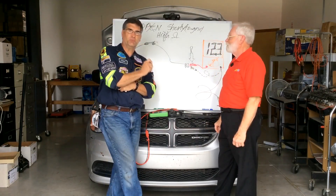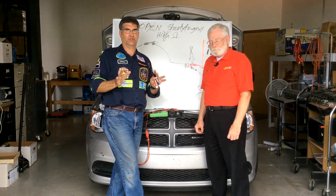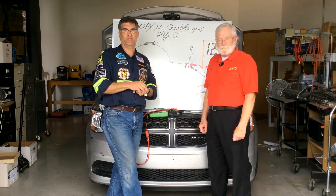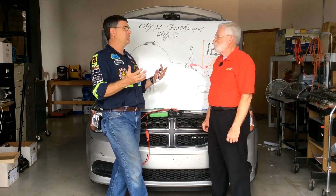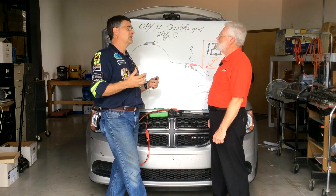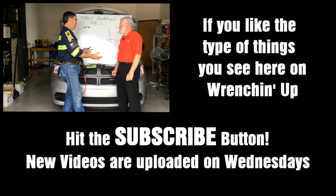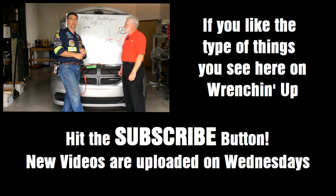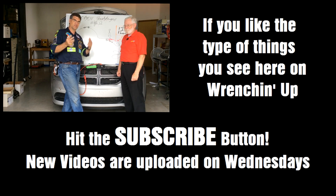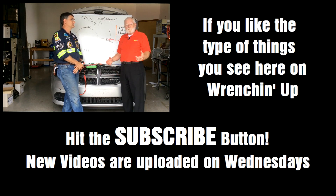The single most important part of this test is that it's a go-no-go gauge for wiring, which is not what you're used to. You're used to worrying about the component. The component fails 20% of the time; the wire fails 80%. So if you have 80% odds of winning, I would never leave Vegas. Every manufacturer will tell you that 80% of electrical faults occur in wires, and the Load Pro is specifically designed to rule wires in or out as the fault instantly. Just that simple.